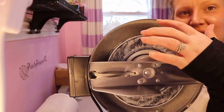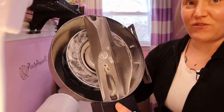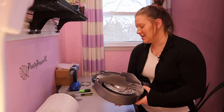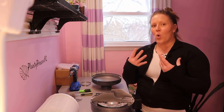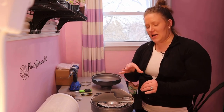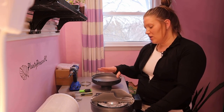Around the fan, which spins so you can rotate it to clean it, you can see all that build-up — even down in here there's a lot of it. For six months of running, this honestly isn't that bad. I would recommend cleaning this every six months to a year and definitely not letting it go past a year, especially if you're running it most of the time. You want to make sure you're cleaning it enough so it is not a fire hazard for you or your plants.